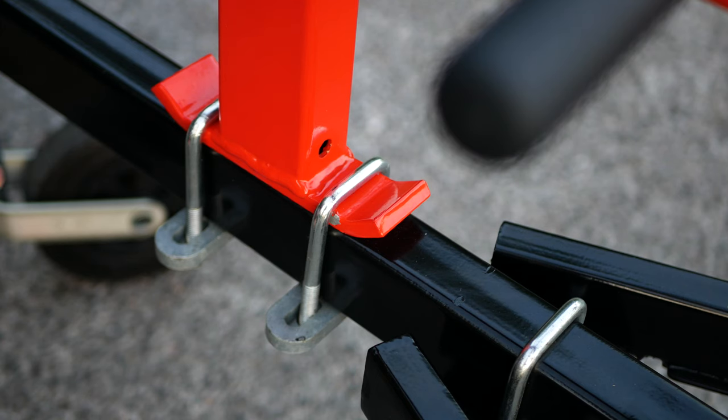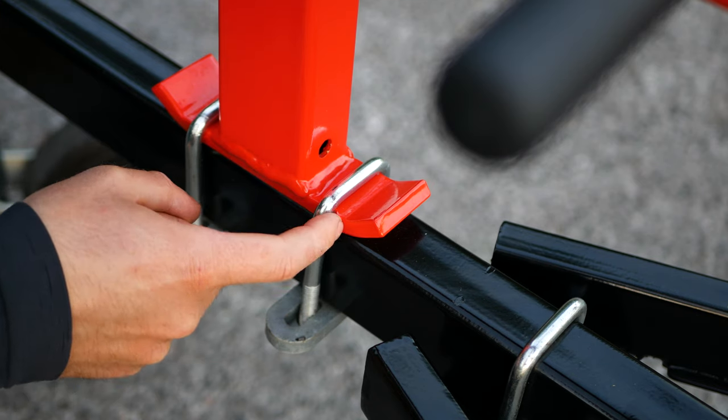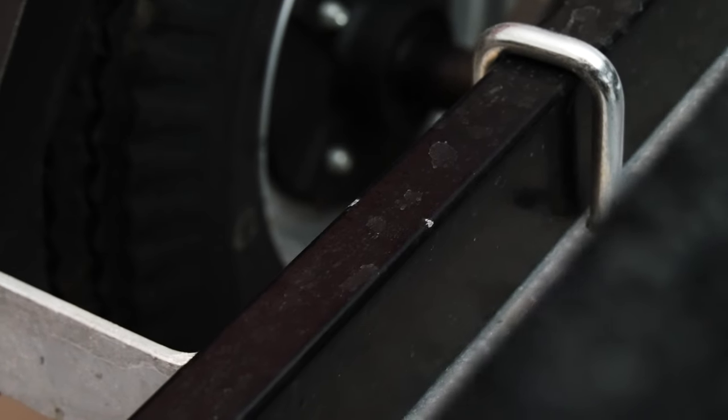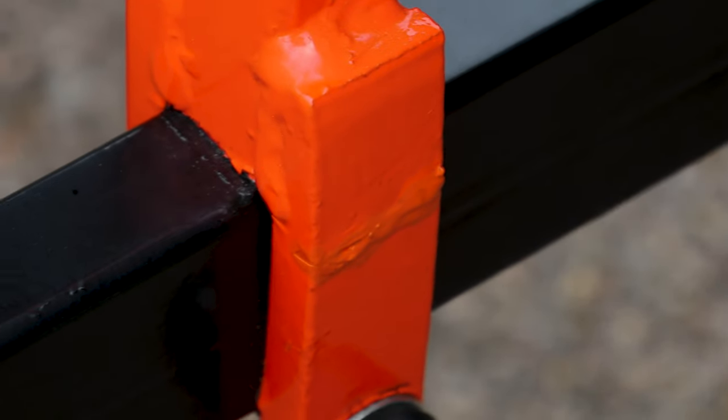Whereas with SBS — and you're going to hate me for this — if you look closely, because they don't have the protectors, you can already see the little chips and bite marks where the U-bolt is essentially biting into the powder coat. I'm not saying SBS powder coating is bad, but by comparison I've already had considerably more chips and cracks on my SBS versus my Xtreme, meaning I've already had to do powder coat repairs.